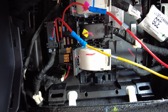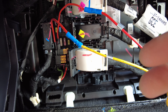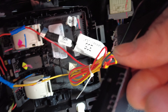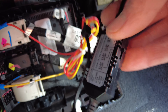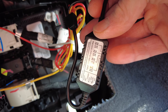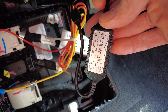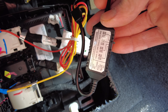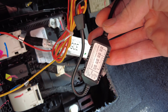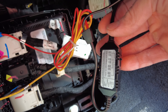I've only ever either done it all off of accessory, so it's just turned on and off with the car, or it's just constant and then you use something like this, which is a voltage detector — which is what this thing also has — because it'll turn itself off. You can use this switch to control what the minimum voltage is for the 12-volt battery before this thing turns itself off. I usually use the highest setting because I'm paranoid like that, but you can do whatever you need to do there.